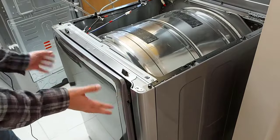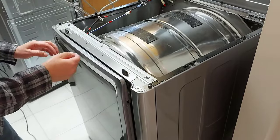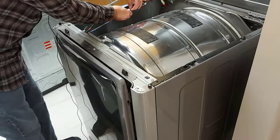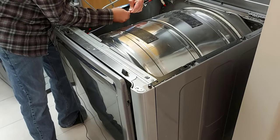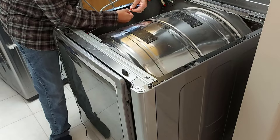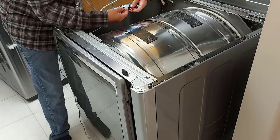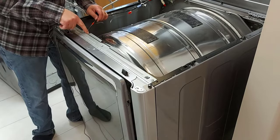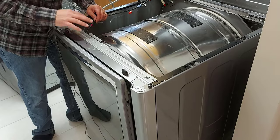The front face of this dryer has to come off so I can remove the drum and the belt. We're going to unhook some wiring. Right here we just pull this wire apart — find the connection, push down on it, and it comes apart easily. Now we have this other wire here. We have to remove these screws and remove this piece to get this wire disconnected as well.